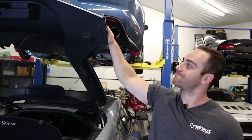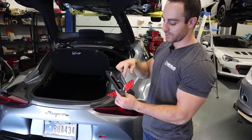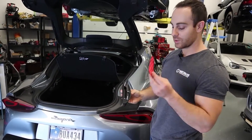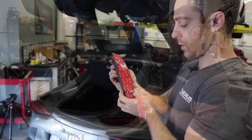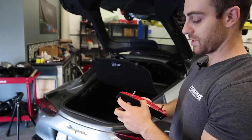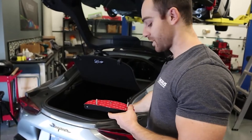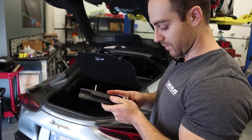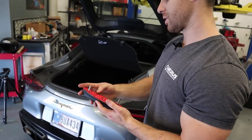To install the double-sided tape, I've already washed off this surface with isopropyl alcohol and water per 3M's recommendation. We'll install the tape using the holes to guide us. This is basically just a weather barrier to keep water out — it doesn't matter because it's outside the trunk seal, but we wanted to at least try and keep water away from getting under the trunk. Next, we're going to remove the red part from the trunk mount and install it onto the trunk itself.